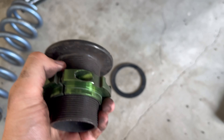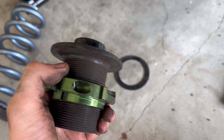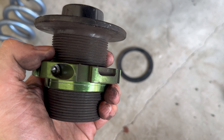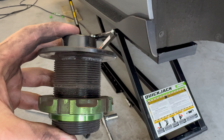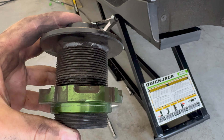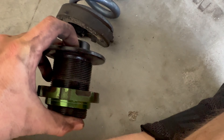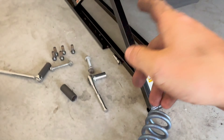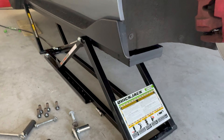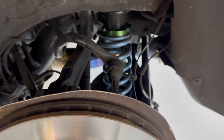It got hot real quick outside — it's Florida. I'm going to raise the rear end about three-quarters of an inch. You can see roughly where it's super shiny — that's where the perch was sitting, so that was about a half inch raise. I think a half inch will be enough to put me at a good position, and that's where these adjustable coilovers come in handy because I can put everything back together, lower the wheel on, and raise it back up if I don't like it. Coilovers are back installed on both sides.